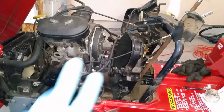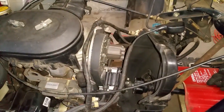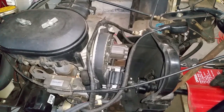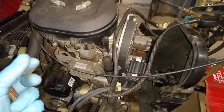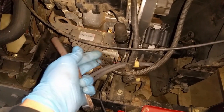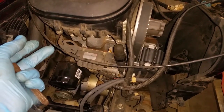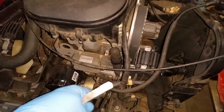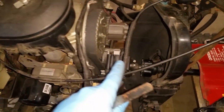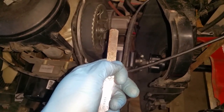Learned from my mistakes — I had to take the pedestal off one more time and the timing belt cover off. I made a mistake on the air gap of the ignition coil. It's 16 thousandths of an inch, plus or minus 8 thousandths of an inch tolerance. I used a business card, but it was laminated, so that meant it was too far away. When I went to start it up, I was getting a spark intermittently, then a weak spark, then nothing at all. This is your ground here — this is what all the safety switches go to. If you disconnect this, it basically bypasses all of the safety switches so that they won't kill the spark. I disconnected that and was still getting an intermittent spark, so I had to take it apart one more time. Use the feeler gauge — 16 thousandths of an inch, plus or minus 8 thousandths is the tolerance.